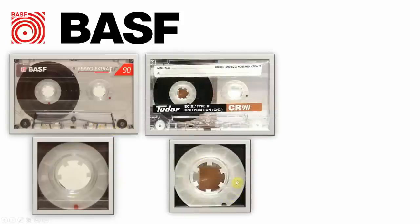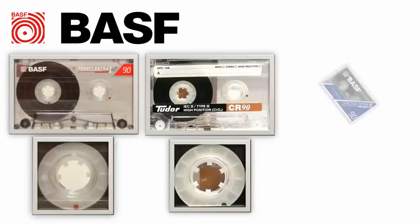BASF was probably the biggest OEM of the lot. Any cassette that says 'made in Europe' or 'made in Germany' chances are it's going to be BASF — and they bought Agfa towards the end, so the lines blur. On the whole, BASF tapes have always been good. Distinctive hubs: they've got little lines on them, no holes, just little lines, held with a retaining peg and another little peg — that's a good sign it's BASF. Looking at the Tudor here, it has the same sort of lines and little rounded ends around the peg. I've seen these type of hubs in BASF Chrome Extras from the mid-80s.